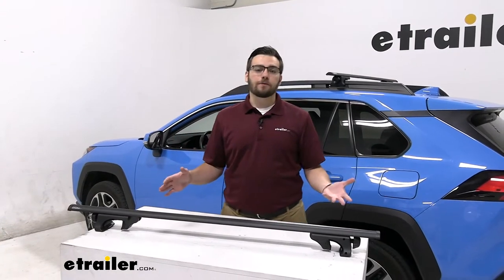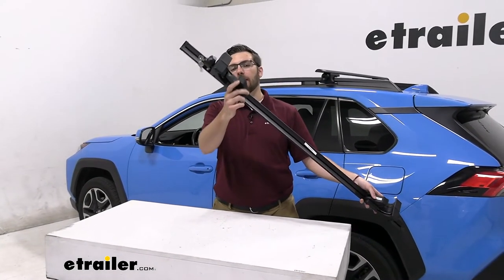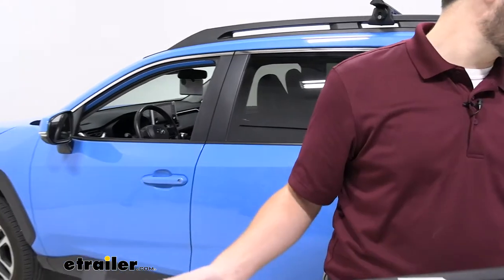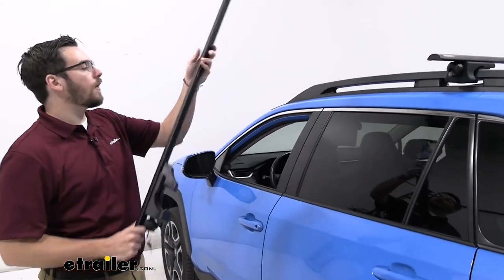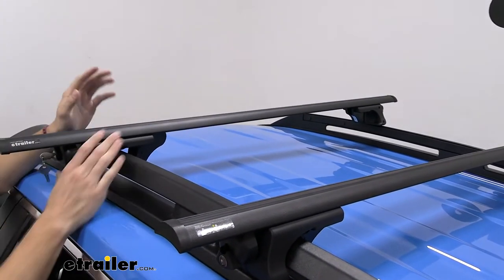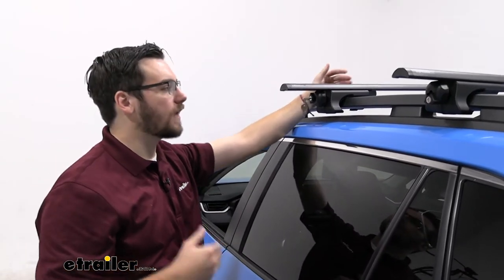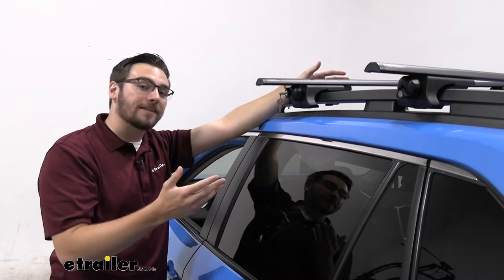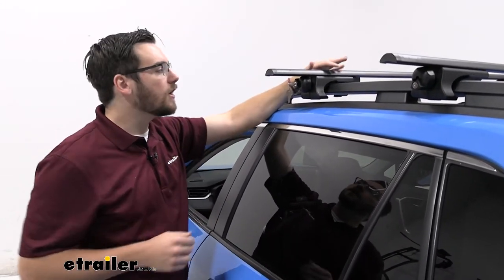For installation, it's going to be really straightforward. Luckily, it comes just like this in the box, so all we really have to do is make sure our pads are at the appropriate length. We're going to go ahead and make sure we can fit that across our raised rails. All we have to do is loosen up and pull them apart, then get it ready to be put across the system. Now, it's important to keep in mind that a lot of accessories are going to have a minimum requirement between your crossbar systems. A good frame of reference: about 26 to 29 inches is usually going to be a pretty good spread — that way, we have appropriate balance for most of our accessories, whether it be bike racks, cargo baskets, or especially kayak carriers.